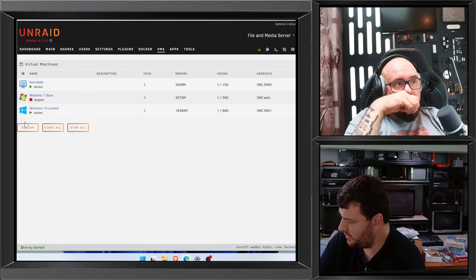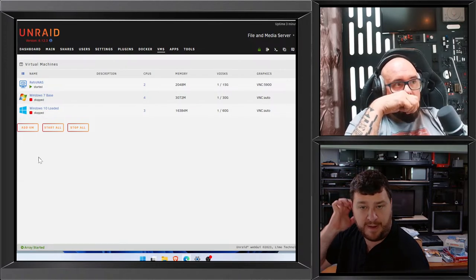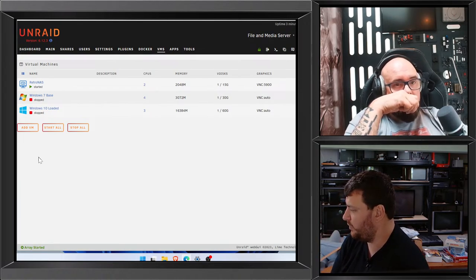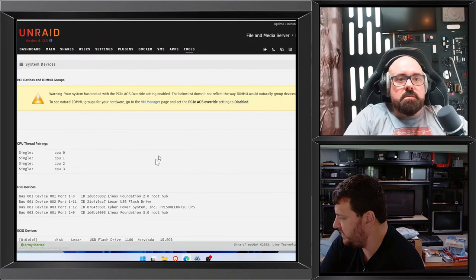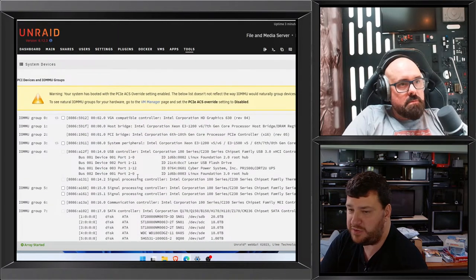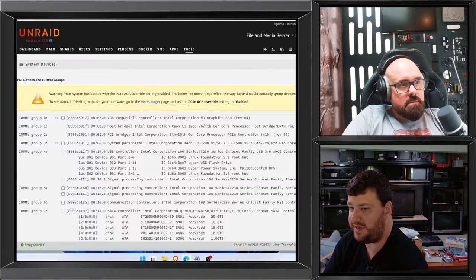Okay, so a basic PCIe device does work. I'm not leaving just that one, so I'm going to force stop. But since we're here and since this is going to absolutely apply to what we're about to do, let's just check in. Let's see if I could pass any USBs through. And if not, I have an extra USB card I could install into a slot. So if we need direct access to Windows 98 through USB, I could have that here.